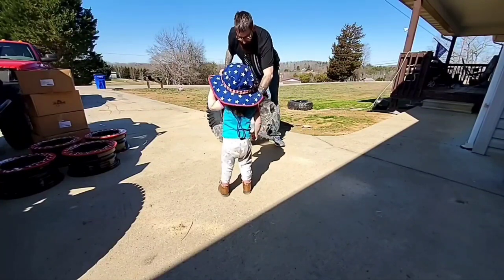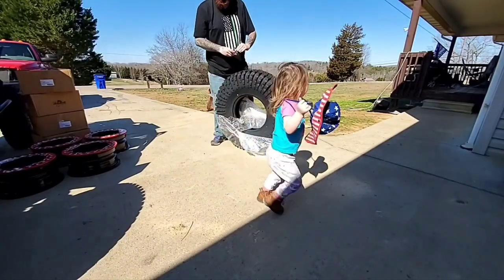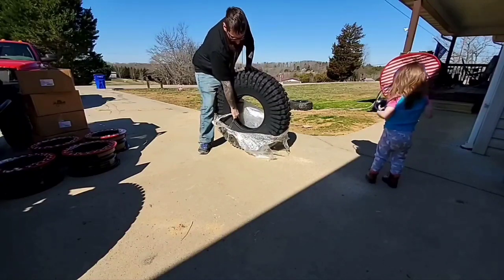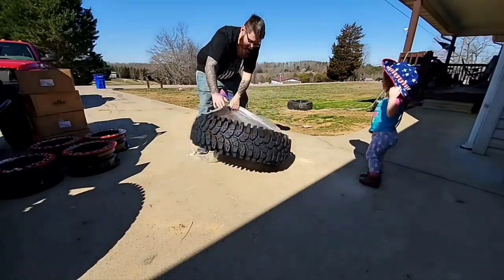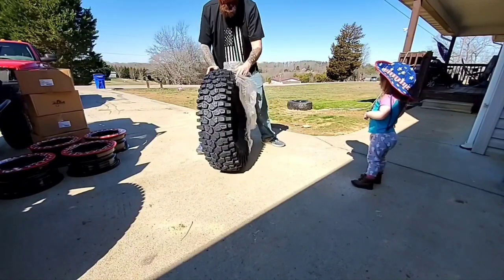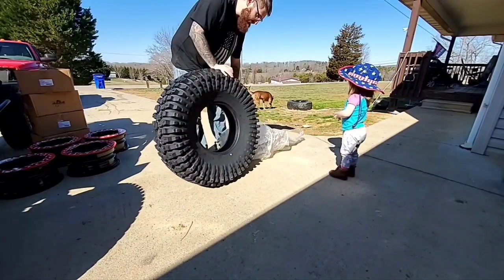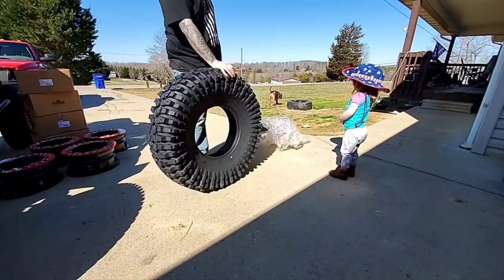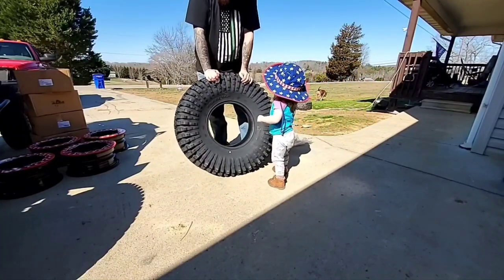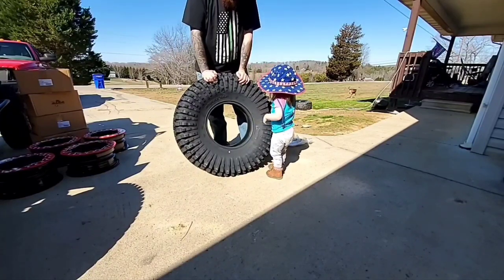We're going to go with Zillas. Got ourselves a fresh set, which I ordered months ago to anticipate that these wheels were going to be here a lot sooner. Also, Roxxzillas have been hard to get a hold of last year. So, the setup we're going to be running is 15 by 7, 4+3s on 35x10x15s.